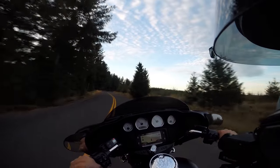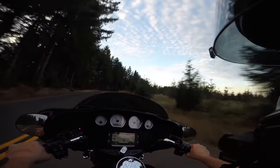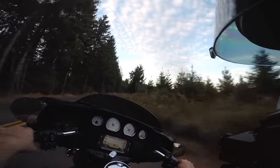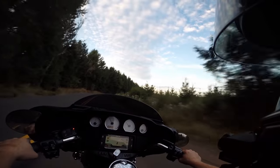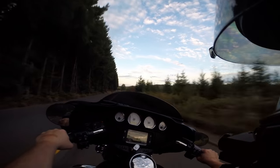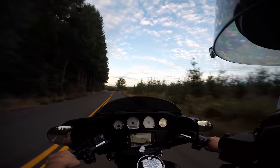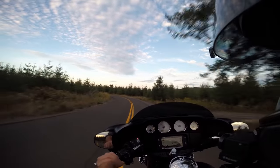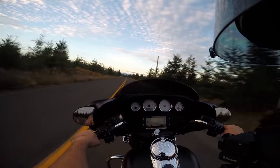So if you tighten everything down with the suspension unloaded, at some point you're going to hear like a pop sound, because it's going to settle. It's going to want to settle with the weight of the bike, so that's why I put some weight on it before I tightened and torqued everything down. Which reminds me, I left that torque wrench sitting at 37 foot-pounds too. You're not supposed to leave those things sprung. This is a good place for deer out here as well.